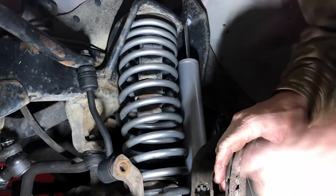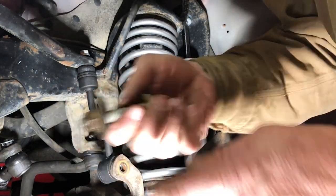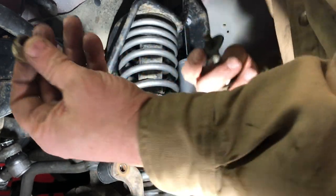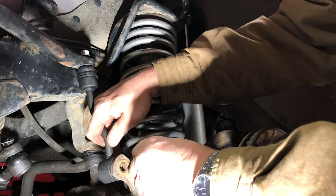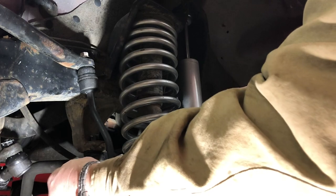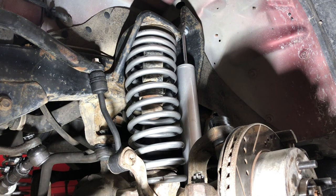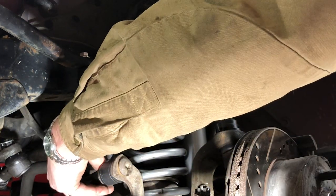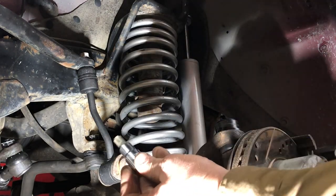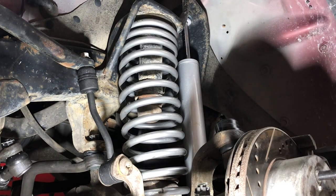Tight while we position everything. And if you remember, we have this T55 Torx screw. So they gave us a new bolt. Love that. Guy in there finger tight. Let's grab the tools we need. Okay. Got an 18 millimeter on the back and a Torx T55 on this side. And we'll go ahead and hold that firm.